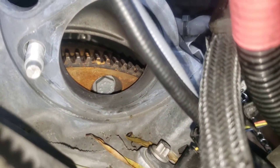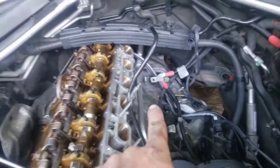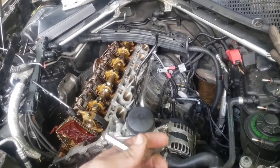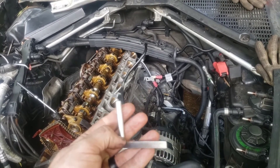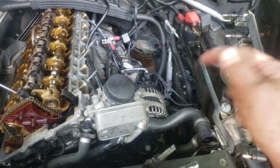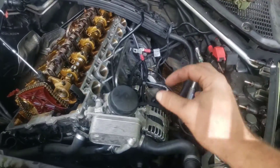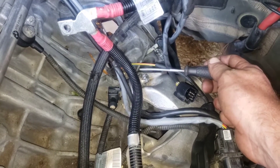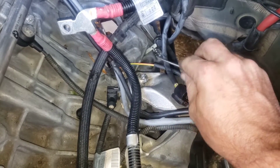Here is my little tool that's inserted. Most people just say 'put your little tool in there,' but I had such a hard time getting that tool into the hole. There are little holes as you spin the flywheel — I used a 7/8 socket to spin the crank and you'll see these little holes in the flywheel. My tool would only go in about partway and needed to go all the way deep. So first you've got to pull this plug out. There's a plastic clip with a little hole in it right down there, and you take a pick, put it through the hole, and pull towards you — I really had to pull hard and wiggle it around to pop the plastic plug out.